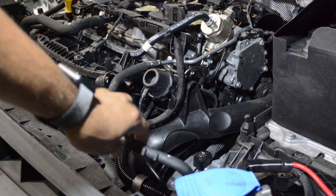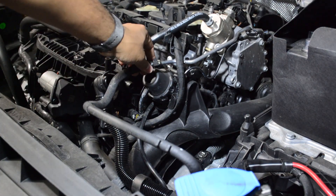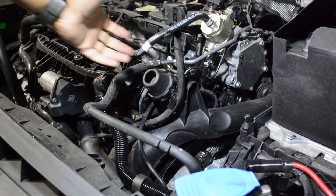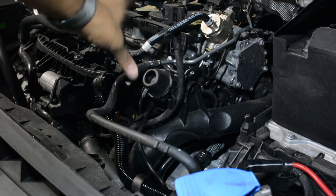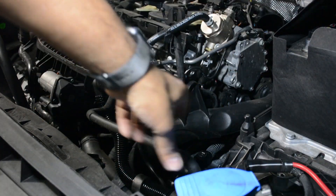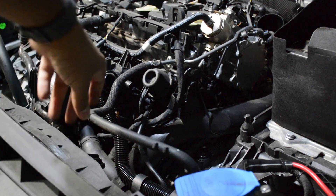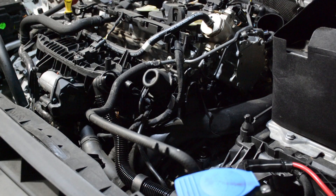So the first thing we're going to do — this is the old coolant line right here. We're going to remove it both at this end and at this end right here. IE actually provides us two vacuum clamp seals. As soon as you pull this out, there's going to be a little bit of coolant that leaks. You just slide the things on there as far as the stoppers on each side, do one side at a time. Also, it's good to lay a rag down so no extra coolant spills on top of the transmission or over the charge pipe and any other components.